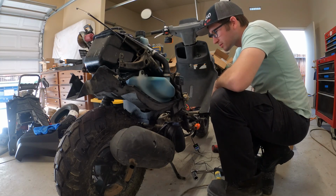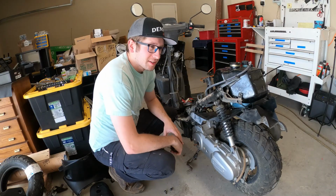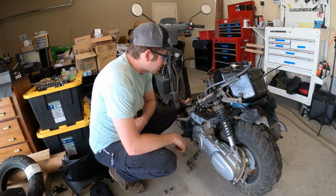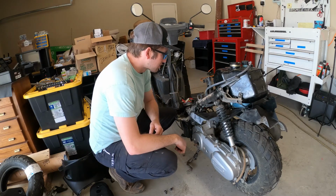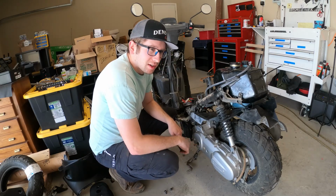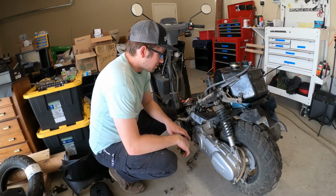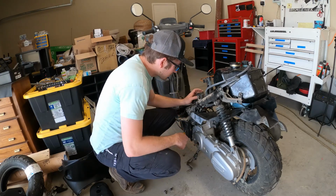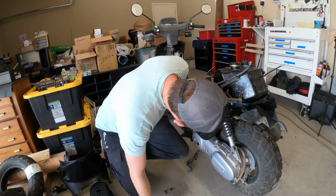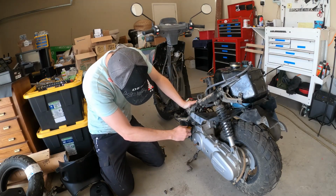Unless it's a fuel thing. I'm really not sure what's wrong. Checked all my electrical stuff. Not seeing an evident issue with resistance or anything. So I think it might be fuel. Like maybe it runs and when it uses all the fuel in the bowl, then it turns off. So I was thinking I'd crack the bowl so it's just slowly trickling.